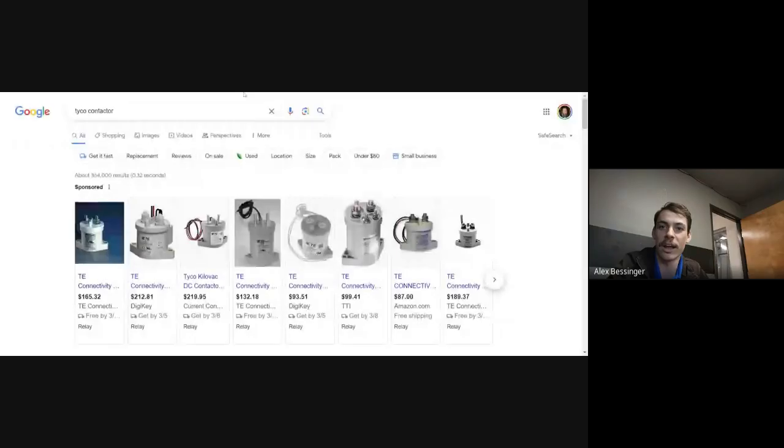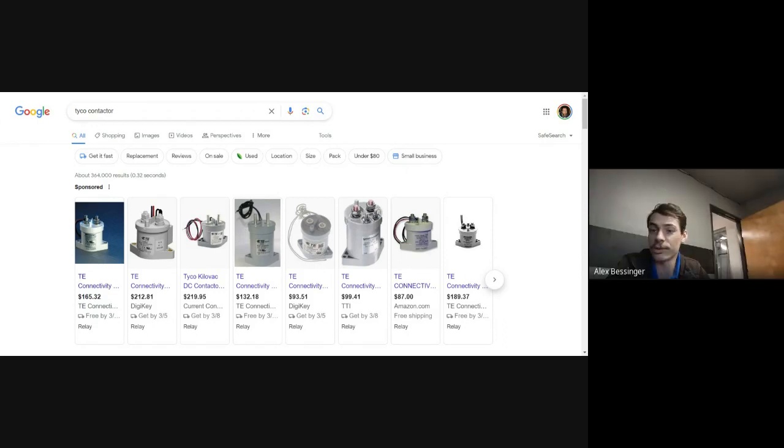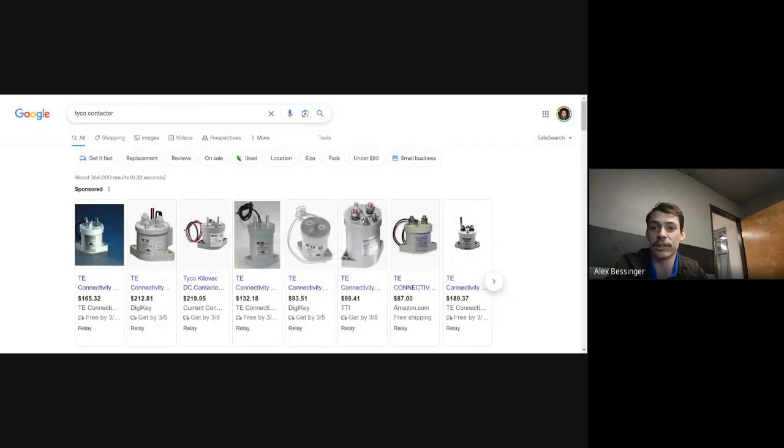And usually when we replace them, we replace them with a Gigavac contactor, which tends to be a lot higher quality, and they last a bit longer. The later revision batteries actually switched to the Gigavac contactors for that reason. Yeah, I think Gigavac is what Revolt's using in their contactor box now. Yep, and that's what the JDMO uses as well, the Gigavac GV200 contactors.